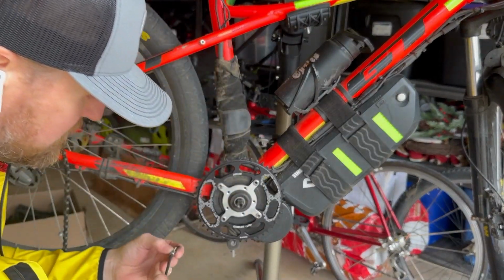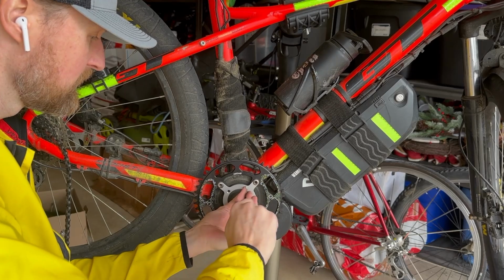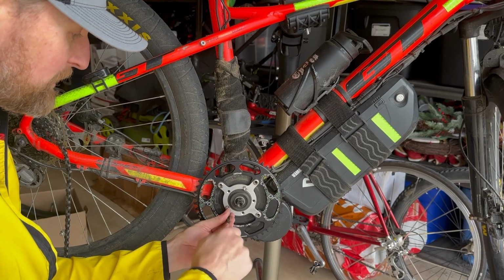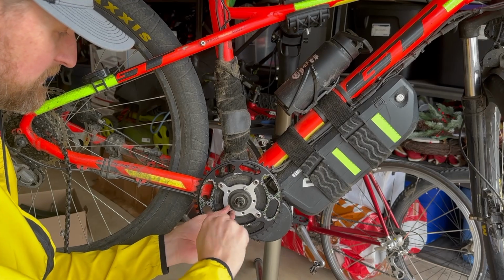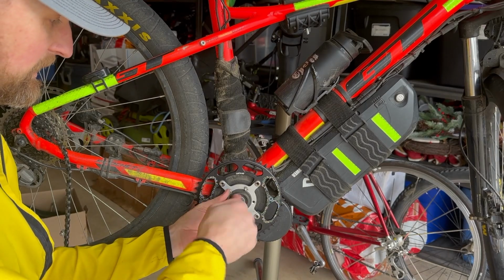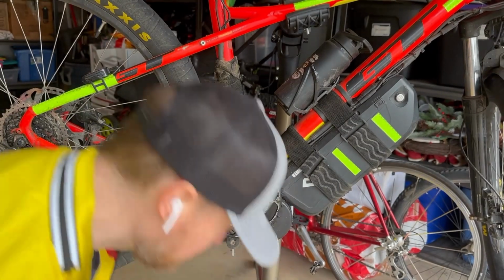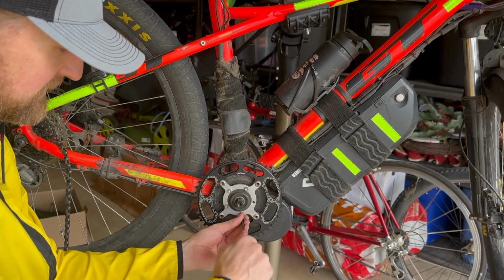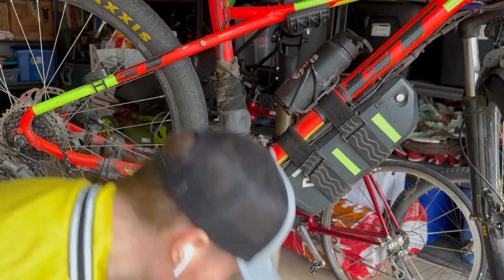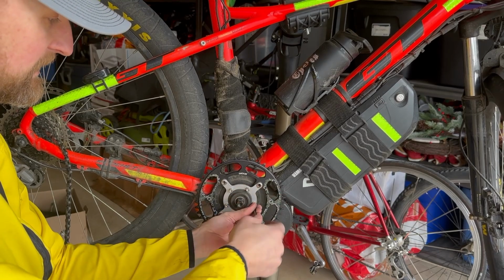It's more or less lined up. Let's throw these in there. It's going to go sort of hand tight for now, and we'll tighten it down in a star pattern so you can get real nice engagement. And with these compression washers, it helps with the bolts backing out, but you might want to throw some Loctite on there. I'm not doing that here yet. I'm just testing this out to see how it works on this bike, and then I'll probably come back and throw Loctite on all this stuff, blue Loctite. I think it's 241. I'll put a link in the description for you if you have any questions there.